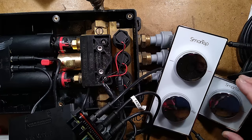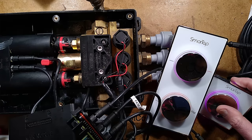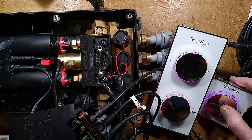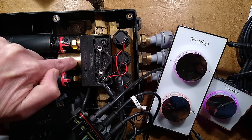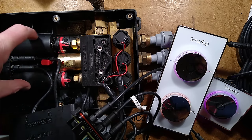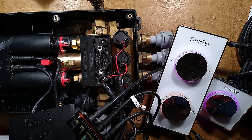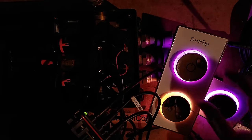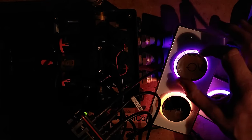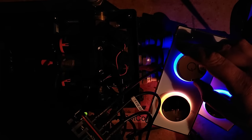Now it's initialized — I'll show you the taps going. I'll just push this button and there are lots of motorized noises as it adjusts the temperature. It's got a temperature sensor in here, probably a safety temperature sensor in here as well, and then it's got the coupling from two geared motors and three solenoid valves to the outputs. If I turn the light off, you can see the buttons here — as you turn the rotary encoder to the left, it goes bluer, a slight sweep of color going through.